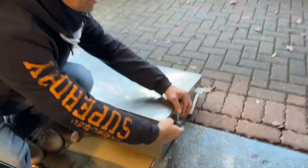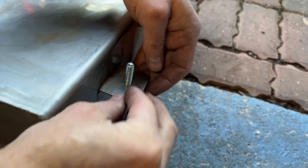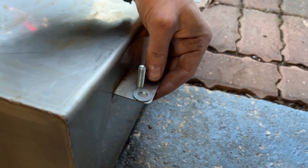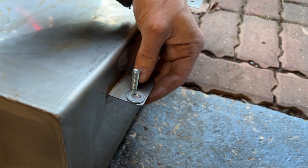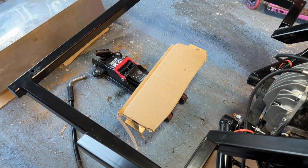Today is fuel tank day. There's nothing wrong with the instructions from AK Supply, but I'm not confident that five fixings going through three millimeter steel is going to hold the weight of 50 liters. Of course it will be absolutely fine, but I like to double up. I'm going to utilize the holes AK have made in these tabs and drill another hole in each one, going up into the frame — two bolts on each flange, a total of ten threaded bolts.